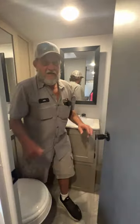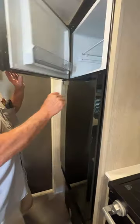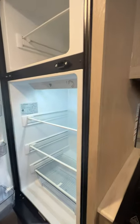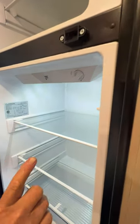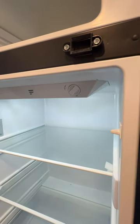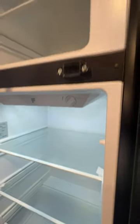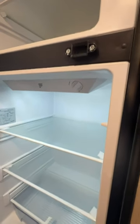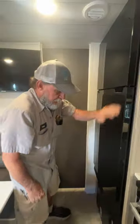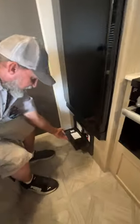It does have a little storage in behind the door there — rest your towels and blankets. Coming back up to the refrigerator: the thermostat is on the lower right-hand side of the unit. We're running at about seven, showing minus 10 degrees in the top and 34 degrees in the bottom when we did our temperature check on that.